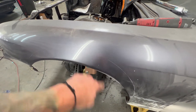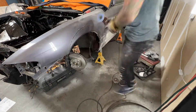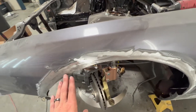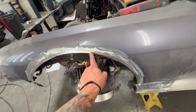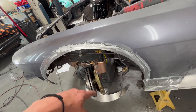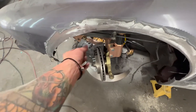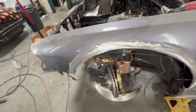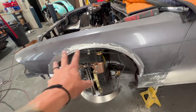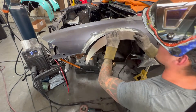Next step: you want all the surface prepped for welding. This fender metal is pretty thick itself, so you can weld pretty easily, and the quality of that metal is really good as well — it welds on real nice. I have a YesWelder MIG setup that's like 500 bucks; it does its job real nice. I'm going to show you how I set everything up right now, kind of tack it on, and then the whole welding process.